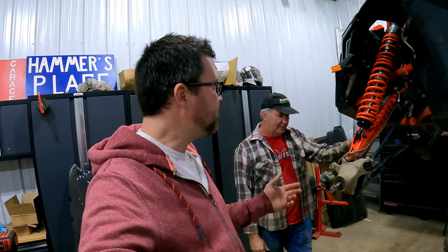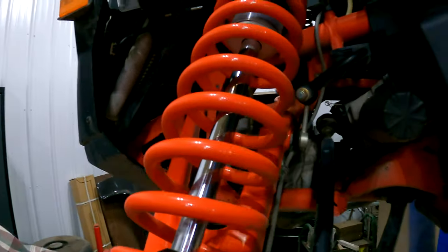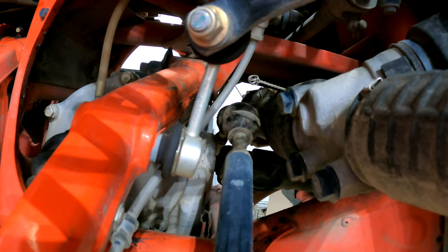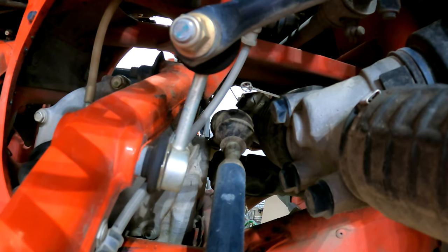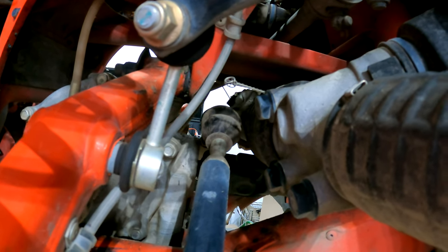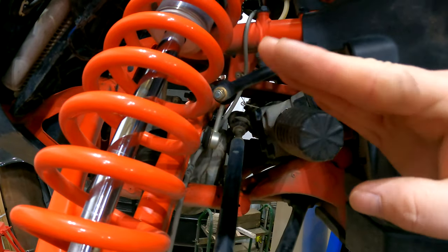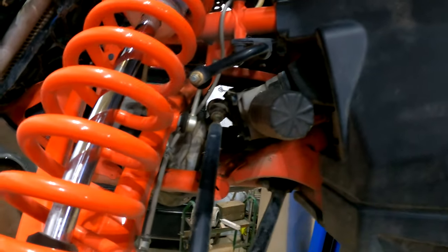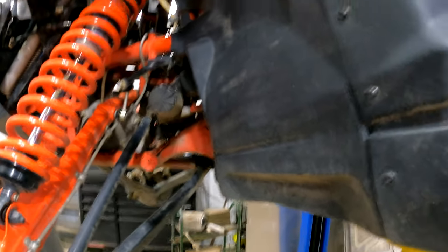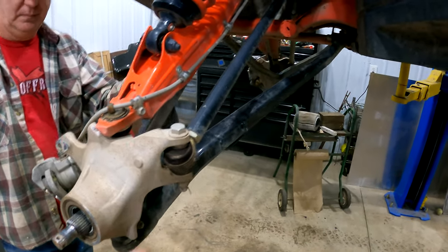One of the first things we found — and I've seen it on my X3 as well — is the steering rack. I'm not real happy about that. It's a common thing and it's bad. It's worse than it shows. What's happening is inside there it's going up and down, there's slop inside whatever keyway holds it in there. We'll talk with our dealer about getting that warrantied.